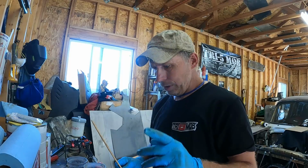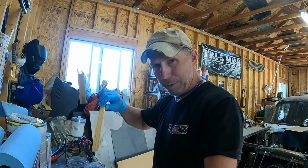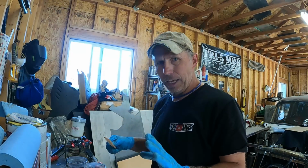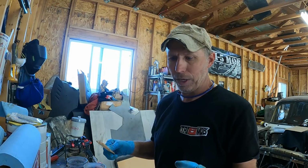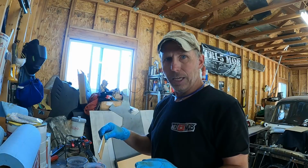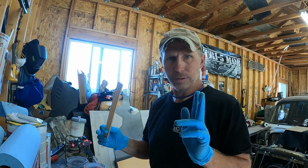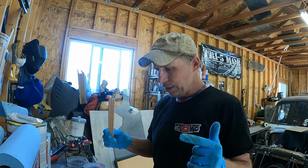All right, so the SPI Epoxy, here's the activator. I got the primer right here. I got the lid off, so I'm not going to lift it up. It's mixed 1-to-1, and they recommend a 30-minute induction time, but they say it's not required. So what I'm going to do is mix it, and then go back to the car and do my wax and grease remover while this stuff is doing its recommended induction time, and then we'll be ready to spray.